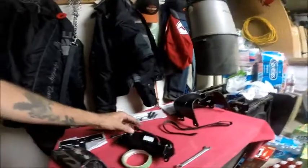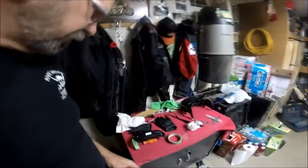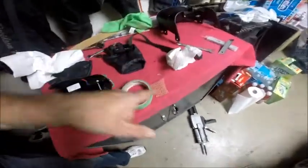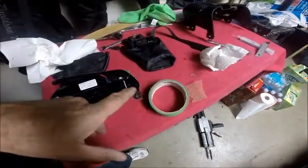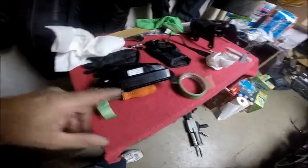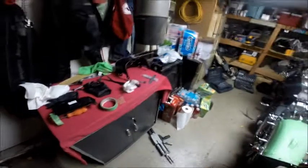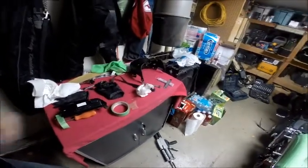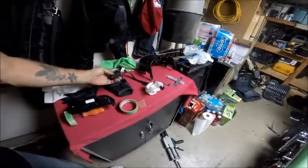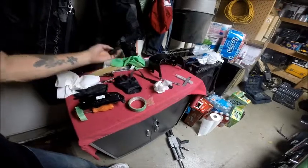Here's the Chinese one and the Harley one — you can see the tail of the Chinese one and how short the Harley one is. What I've done is I've taken drywall tape and cut it out to go on the back of this, put the panel bond right on top, then put the tape over top to squish it in there. This should reinforce the backing — it's almost like a carbon fiber. The panel bond is 3M; I'm in the bonding business so I get it from a dealer, but you might find it at AutoZone or Pep Boys.